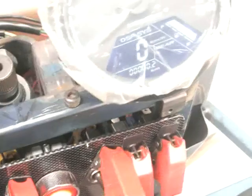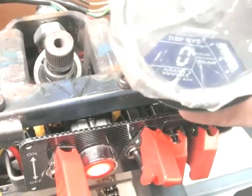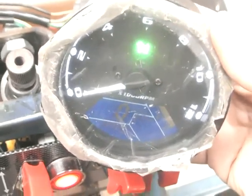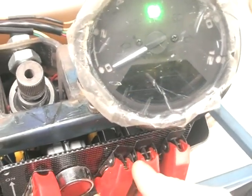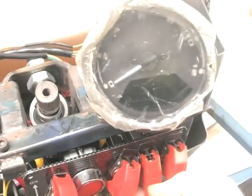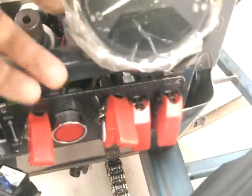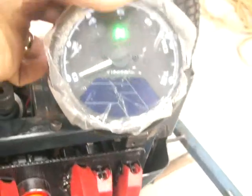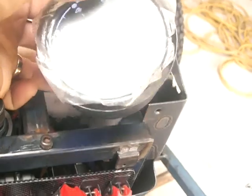In terms of the speedo, there are five fields. There are some instructions in the description — it's from China, it's written in Chinglish. It's very hard to understand, so I'll go through what I've found and how it actually works. To get into the mode settings, turn it off, and before you turn it on there's a button at the back. Have that button pressed and turn it on, hold the button down for five seconds, and it will go into mode one.